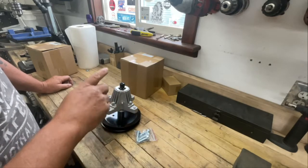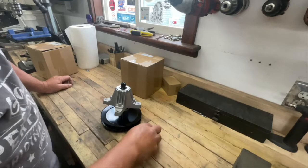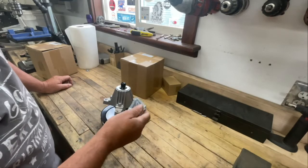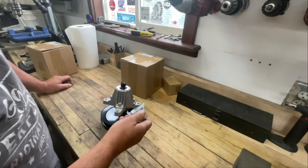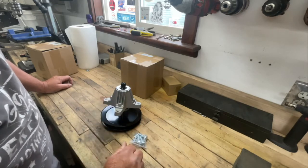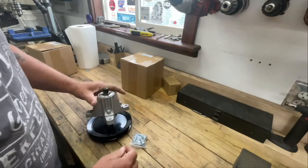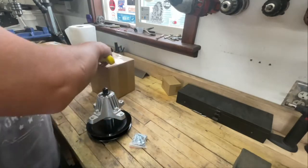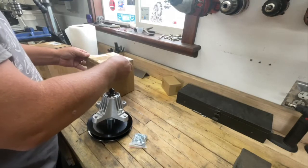One thing I really like about these spindles as opposed to the original Cub Cadet spindles is that they pre-drill or pre-thread all the holes for the mounting. When you buy Cub Cadet, those holes are not threaded — they give you self-tapping screws and the installation of the bolts makes the threads. I don't really like that because you have a good opportunity to screw it up. So when I put these on, I'm going to put a little bit of blue Loctite on them to make sure they don't loosen up during use. Very good quality construction. The bearings feel extremely smooth, no grittiness. We've got a cast aluminum housing with cooling fins, just like the original equipment spindles — it's very hard to tell the difference.